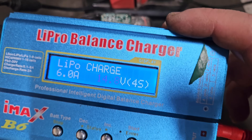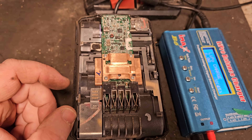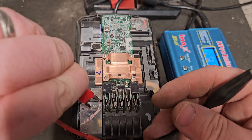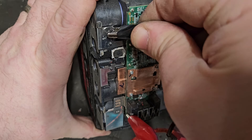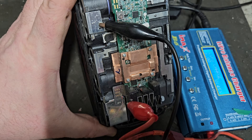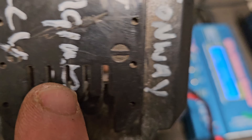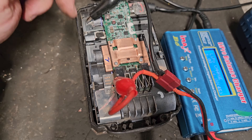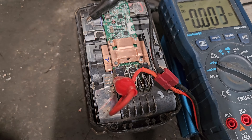The way we do this is with a lithium ion balance charger - a B6 iMax B6. I'll put the link in the description for that. You have to know what you're doing - you have to know the polarity. If you're unsure, you have a multimeter there. You can see from the top that is the plus, and someone has written that that is the minus, so I'm going to the plus terminal and the minus here.